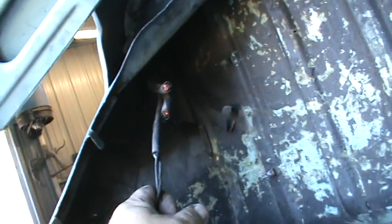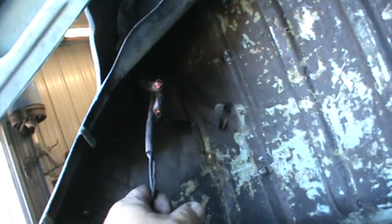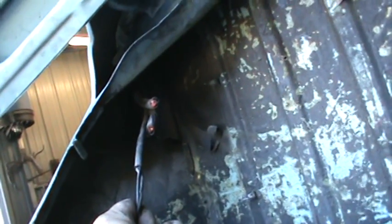I just wanted to point something out to you Volkswagen guys — if you do plan on putting a wiring harness in, leave this part in. What you can do is attach the new wiring harness to the front or the back, whichever you prefer. It's usually easier from the front and you can pull it through with the old one. You don't want to pull that out until you use it to pull the other one through. Tuck it out of the way, paint around it, fish it out of there, and tie the new one to it and pull it through.